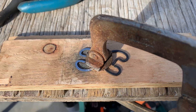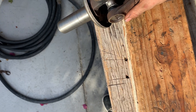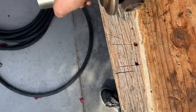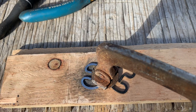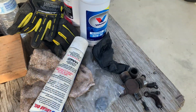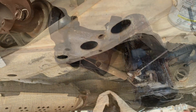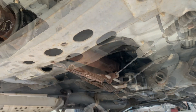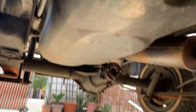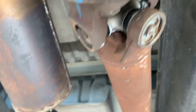I've had to file about every last one of these snap rings down. Right now I've got these U-joints set in exactly where they're supposed to be for it to move nice and free side to side. I popped in the last two on this side, put the bracket on the part that goes into the differential, and we're ready. We got the front half in, and now we're connecting the back half and screwing the U-joints into that plate. The only thing left to bolt down is the carrier bearing, and we're going to final-tighten all of these, and then we'll be ready to test her.